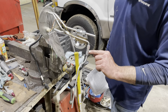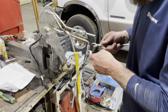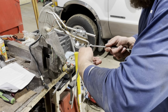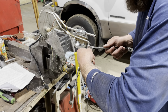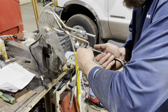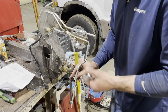You've got a 9/16 here and a 5/8 here. So we're gonna tighten down TK-05290-12-HBUS because that's what we're told to do. So again, always with the compression fittings, you wanna keep the one in place and tighten the cap down so that way it doesn't spin on the piece you're attaching to, and it only compresses the ferrule, like a feral cat, but spelled different. F-E-R-R-U-L-E. It was in the spelling bee when I was a kid. So get that snug. Again, we make sure it cleared the sending unit so it can do full swing.